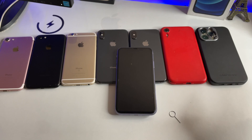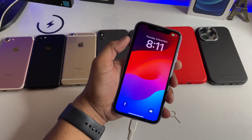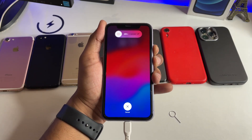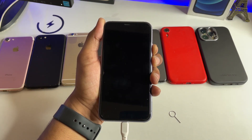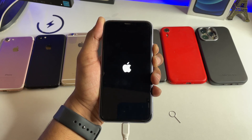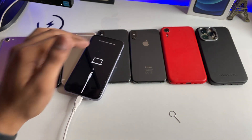What you have to do is simply connect your iPhone to a laptop or computer. Then press volume up, volume down, and keep pressing the power button until it switches off and jumps into recovery mode. Do not release the power button when you see the Apple logo. Leave all the buttons except the power button and let it shift into recovery mode. Our iPhone is now in recovery mode and connected to the computer.